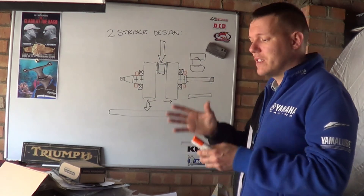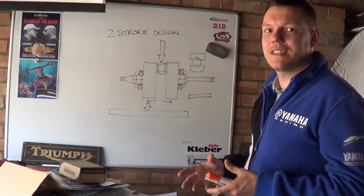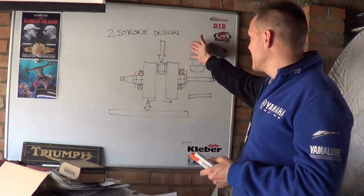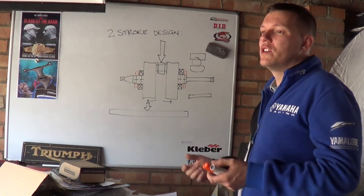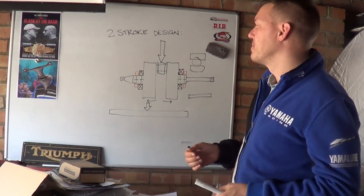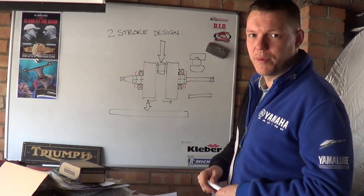Ball bearings are designed to take radial and axial load. Basically this is a hardened steel face, precision ground, so it can take that thrusting. Usually you end up putting a radius on the inside of your web here, and that is pretty much where it rides. But if you add an oil seal — which is basically just a thin sheet metal pressing impregnated in rubber — that is not going to stop the thrusting of the crankshaft backwards and forwards, and you would have horrible failures of the crank rubbing on the inside of your cases.